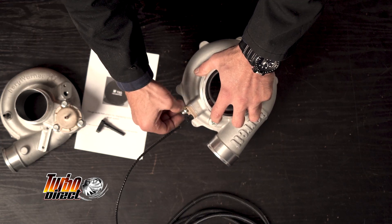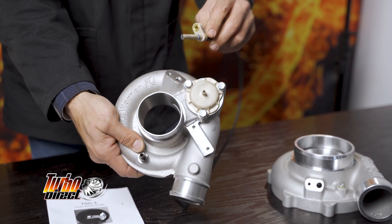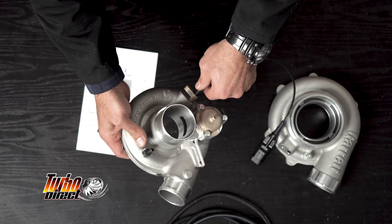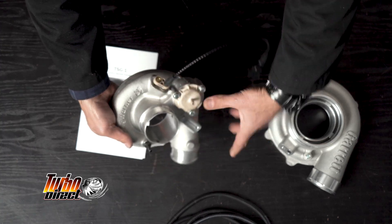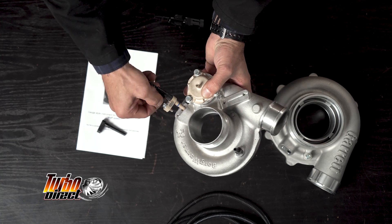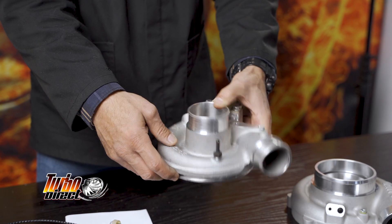It is also compatible with BorgWarner. This is a 7163 compressor housing. This housing is not drilled — there's no hole drilled all the way through the radius profile. However, you just need to drill through the last little bit of the housing to fit this sensor. The screw that comes with the sensor will go straight through and screw into the pre-drilled and threaded hole. This is exactly the same for all BorgWarner EFR as well as the Airworks range of turbochargers.